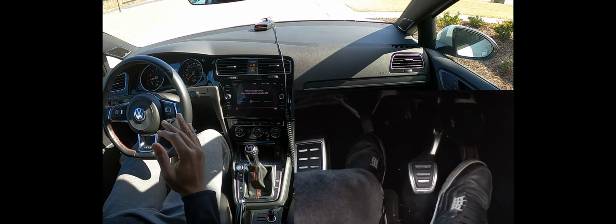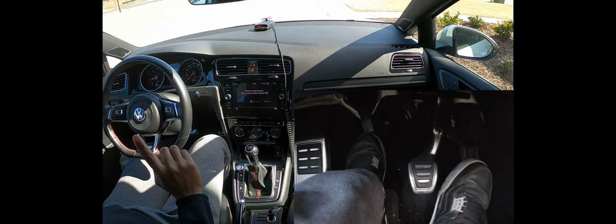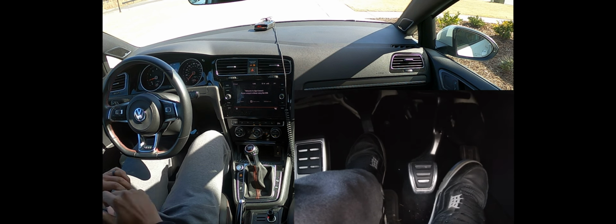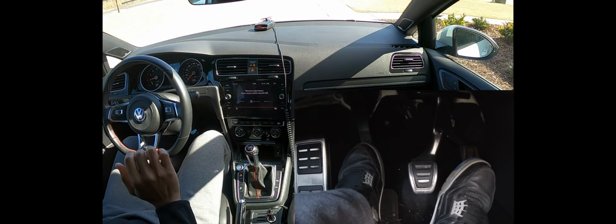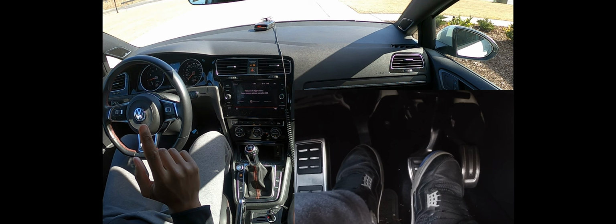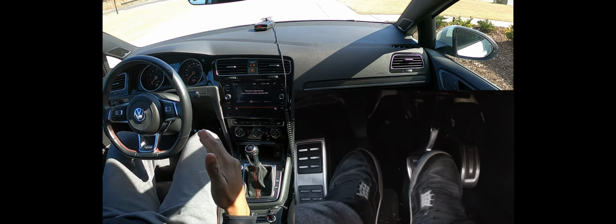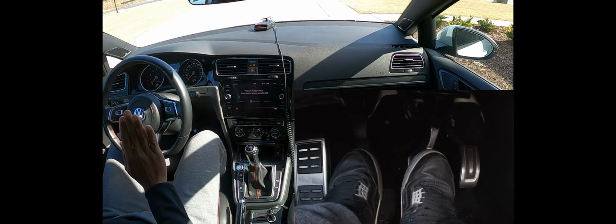Now the key thing here, putting down your handbrake, that means the vehicle may roll. But here's the key, right? When you're in the vehicle, foot down on the clutch, if I start to let off the clutch without pushing the gas, well, in this case, this is a newer vehicle. Older vehicles, it kind of shut off on you. It'd do something like this. It starts to shake a little bit, and then it shuts off. Why? Because we're not actually engaging to move forward in that motion.